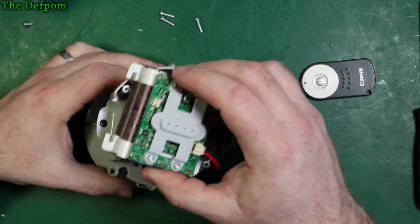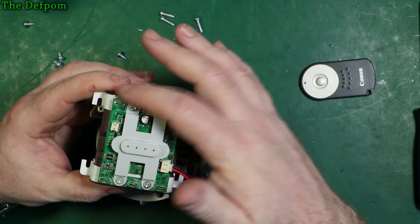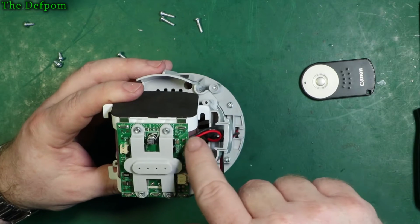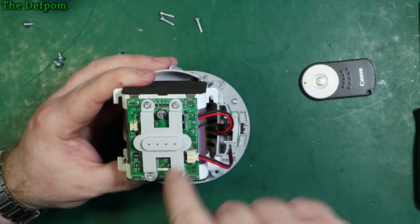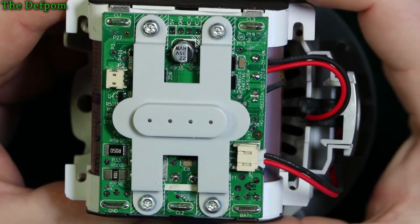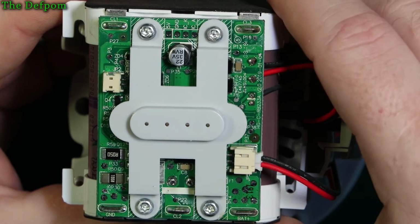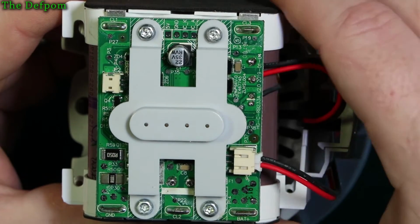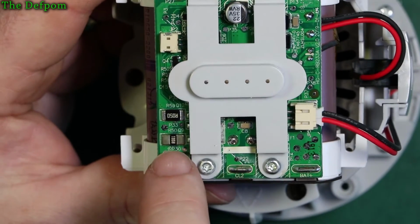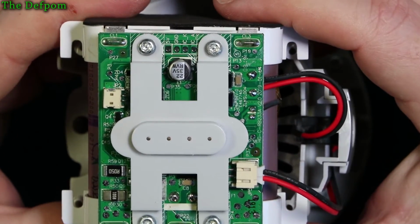So there's a bunch of circuitry under there as well. That looks like it's soldered directly onto the tabs here, so we won't be getting that board off anytime soon. Yeah, so you've got tabs here, there and there, there and there, no tab here. So that's interesting. Ground, battery positive, CL1, CL2, CL3. 5V, ground, ICK, ICA. Is that a serial connection? Interesting. Okay, so we've got some R001 here, so that's probably a current sense resistor, checking the output from the motor so it can monitor its output, make sure it's not overloaded.